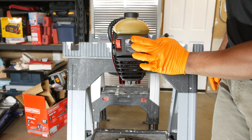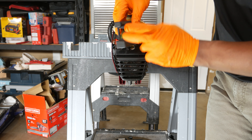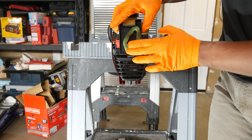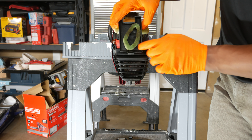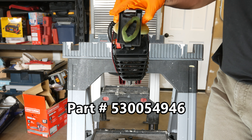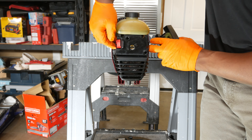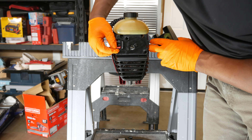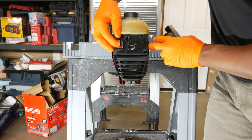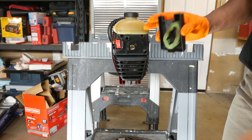Let's check for air next — that means taking the cover off where the air filter lives. You press on the side to release the tab and remove the cover. Inside the cover we've got our air filter. This one is pretty dirty and probably should be replaced — I think it's original to the trimmer. I could clean it up with some hot soapy water, and I'll also look on Amazon to see if I can find one. Right back here is the inlet for our air. The carburetor looks fairly unobstructed — nothing in there that I can see. In terms of air, I'm not really concerned about that being our issue. I'll clean this filter, but I'm going to jump next to fuel.